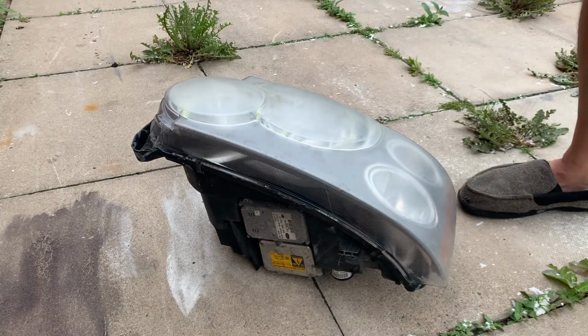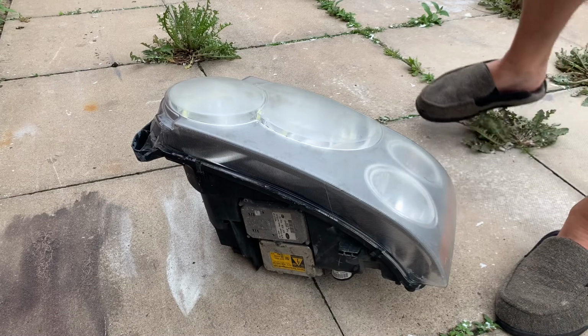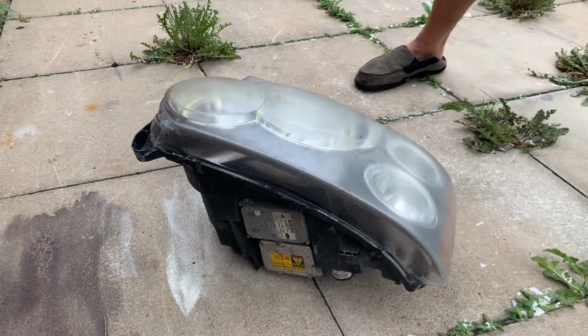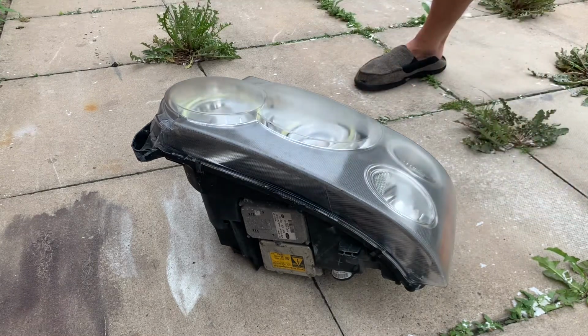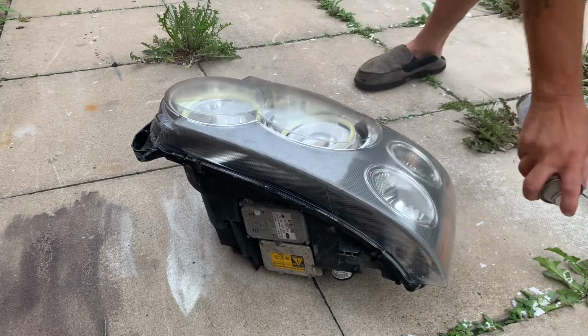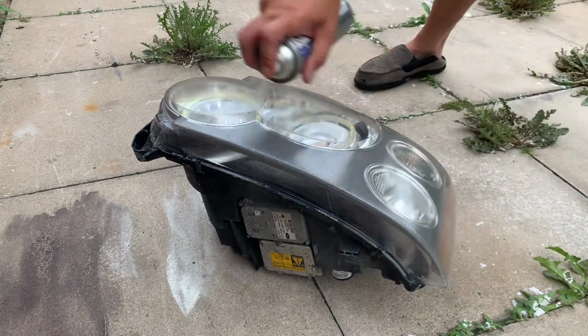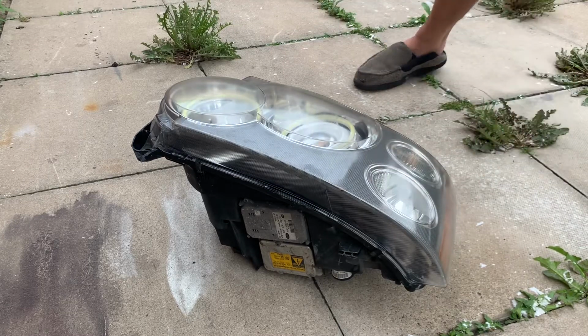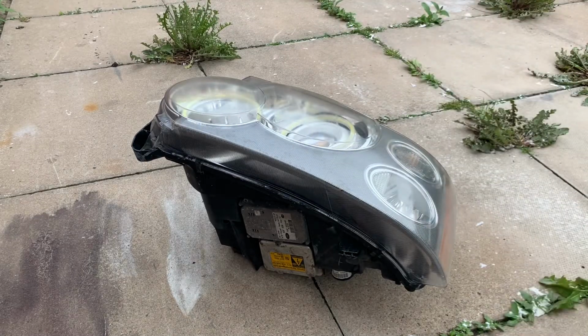And firstly, a very light coat. Test the nozzle. Straight lines. That's it for the first one. Let that stick. Give it something to stick to. And then back again for another one in about 10 minutes.